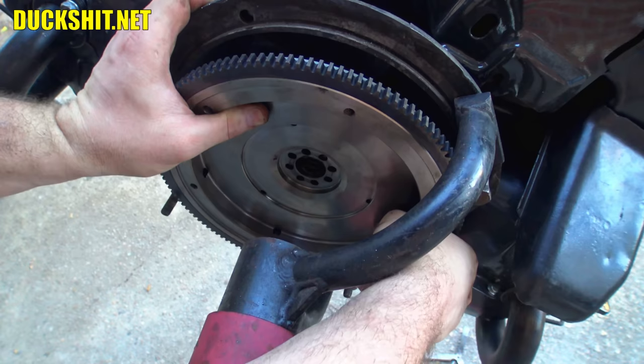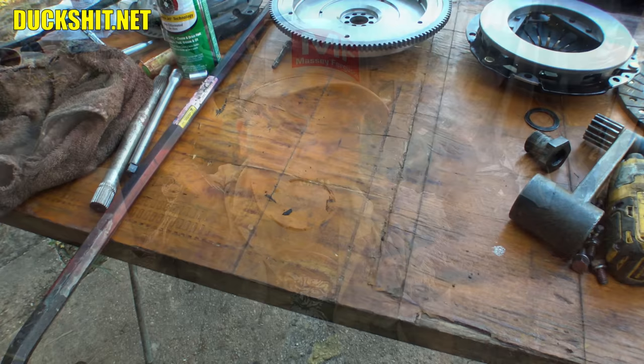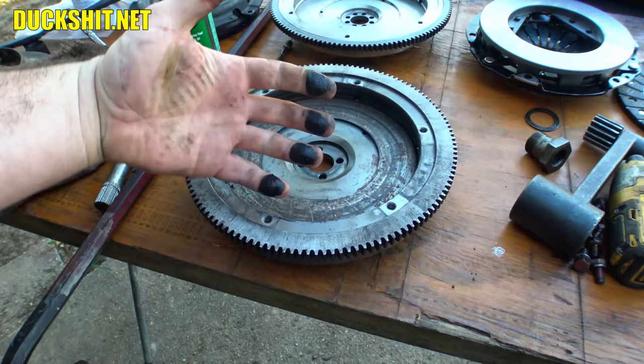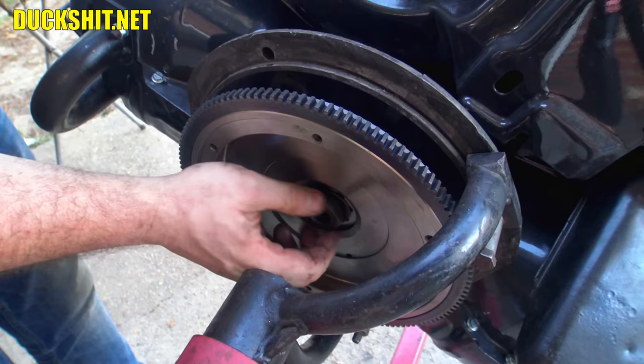Duckman, did you know that a lightened flywheel will rev up too quickly and spin right off and break your crankshaft if you don't use all eight dowels? Oh no! I don't even know what to say to that one. If anything, a stock flywheel would be more likely to break the crank on account of having more inertia and more momentum. That's not even the reason for needing eight dowels. But how's a flywheel spinning faster than the crank to begin with? You know, this is up there with the free energy people. The lightened flywheel just going to make power, yeah, like perpetual motion.